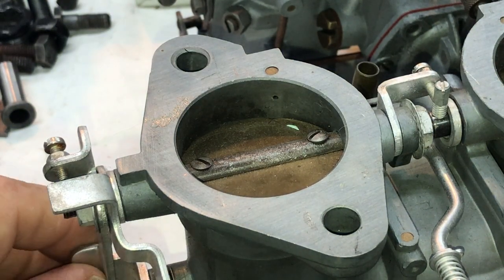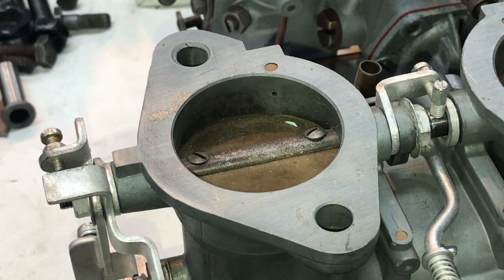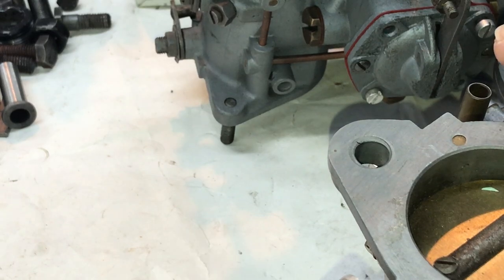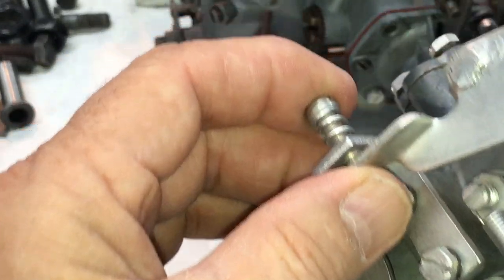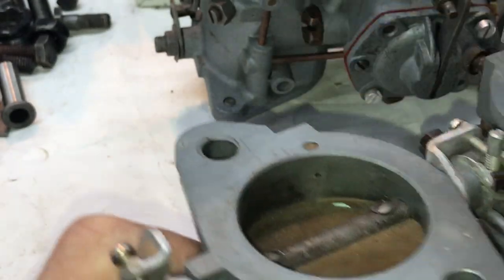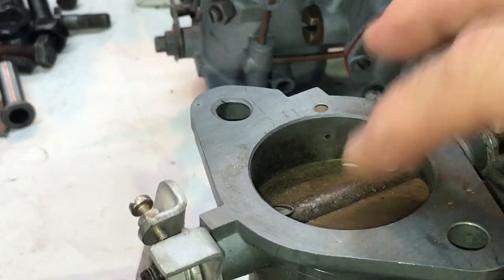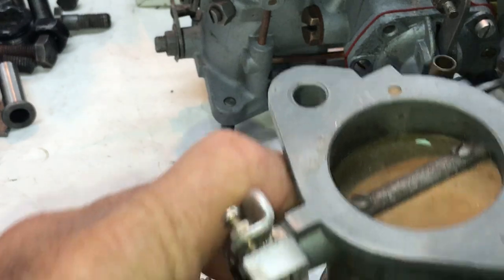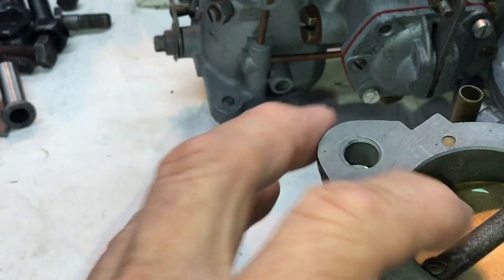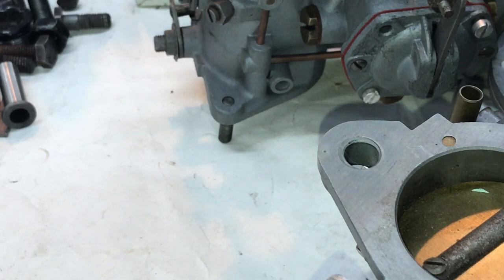And that's also part of the angle of the butterfly, so that's something else that needs to be looked at in terms of the throttle not closing all the way and the butterfly's angle — this 13 to 17 degree angle — hitting the inside of the barrel. Mentioning the butterfly being too big: no, I don't think that's an issue as long as it's got the right angle on the edge of the butterfly. Hope that helps a little bit.